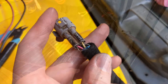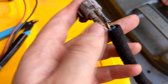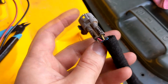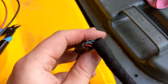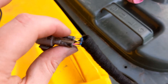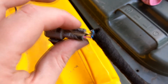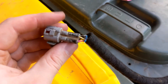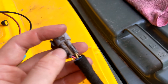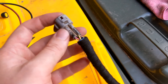I've just taken the sensor back out of the gearbox, took the pins out of the connector, poked the resistor through the little rubber grommet, and wrapped it around the sensor. I'll solder this properly if it works — for now I just want to be as least intrusive as possible. I've checked it with a multimeter and I'm getting 10k ohms between the signal and power, so now I'll put it back in and test it.